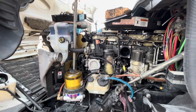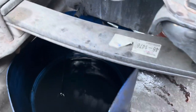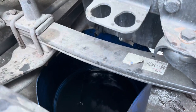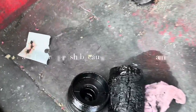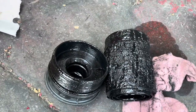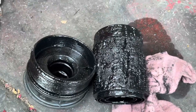The oil has to come out — dump it. Doesn't matter how new it is or how good you think it is, start with new oil. Take a look — this is what it looks like when you have oil in your coolant. That is going to be because of the module, which I'll show you in the video. This is why you have to dump the oil.